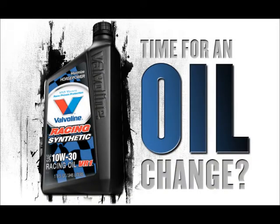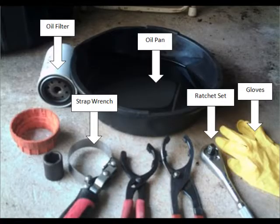Changing a car's oil on a regular basis is essential for every car. Without changing the oil, the filter will become clogged with dirt and debris, and the parts of the engine may start to rub together or wear out prematurely. Changing the oil on your car on a schedule, either every 6 months or every 3,000 miles, is what is recommended by most car manufacturers.